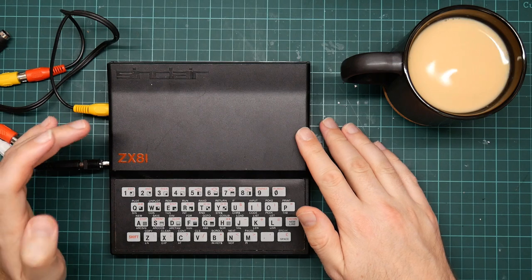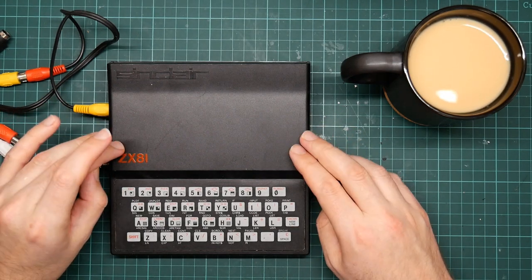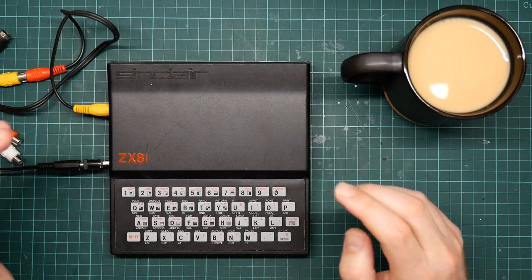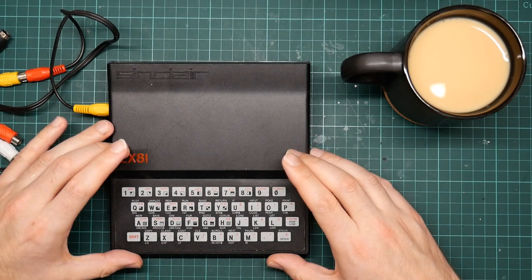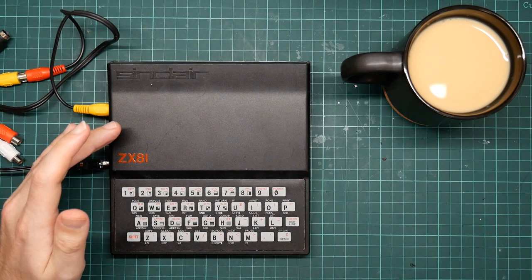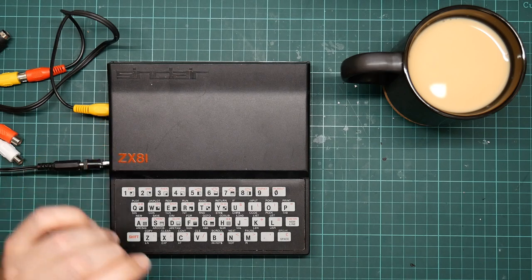I am not having a lot of luck with my keyboards recently. Not only has my Amiga keyboard failed due to membrane failure — there'll be a video about that coming out shortly — but my ZX81 keyboard has also failed due to membrane failure. This is pretty normal with these old computers. The membranes are made out of pretty brittle plastic which gets more and more brittle as time passes.